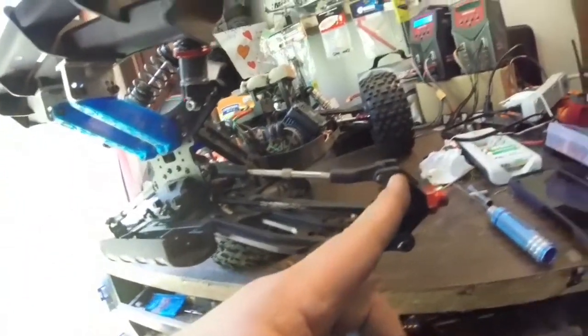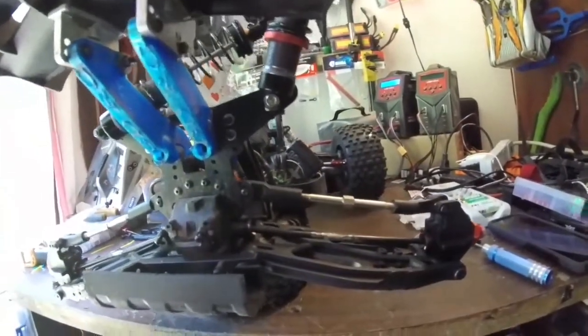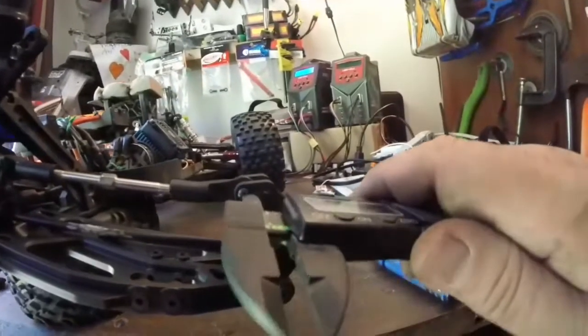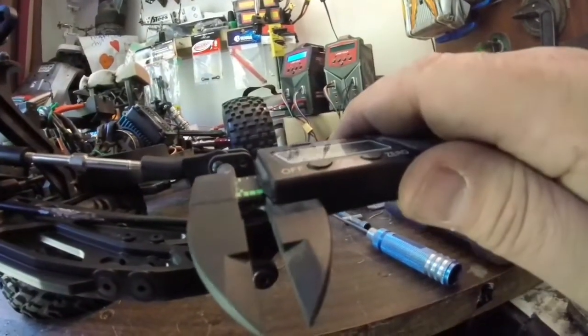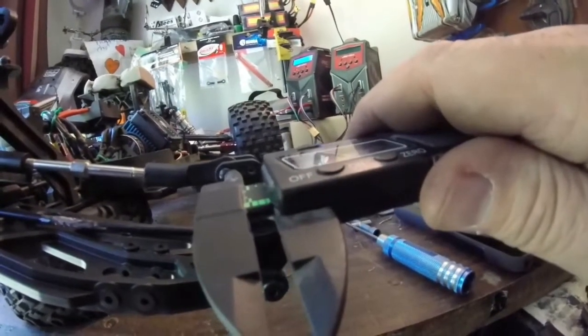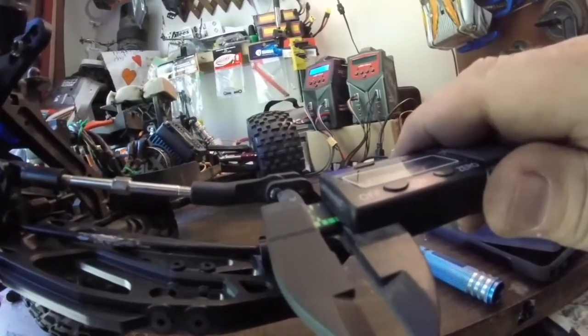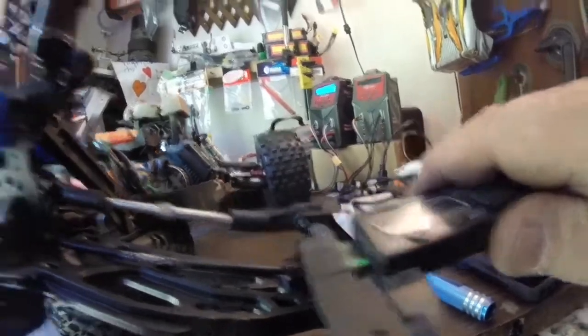In the end it's just making this car eight millimeters wider, because the control arm is a little bit wider. You put them on — they come with stock in the middle hole, so you move that to the inside hole and that gains you four millimeters. I should probably measure that to see what it really gained me, but it looks like about four millimeters. Let's see — six millimeters. Well, at the end of the hole it gained me more than enough. It's good to go — about five. These are about four long, so that gives you what you need. It worked.